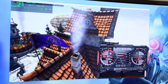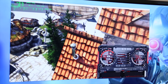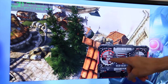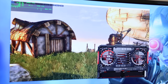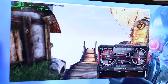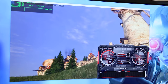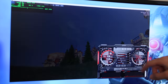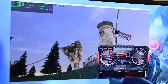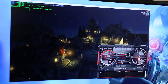This test has been running for a couple of minutes. The core clock is bouncing between 1898 and 1923 MHz, and temperatures are sitting at 68 degrees Celsius. Everything is completely stock except the fan curve, which is set to a static 60%. I'm going to let this run a while and see where the core clock and temperatures stabilize before taking the card apart.